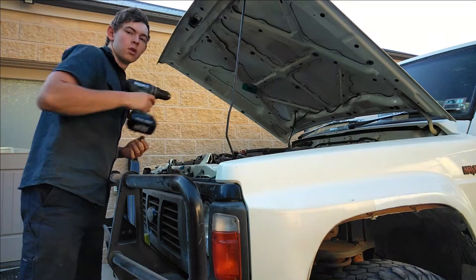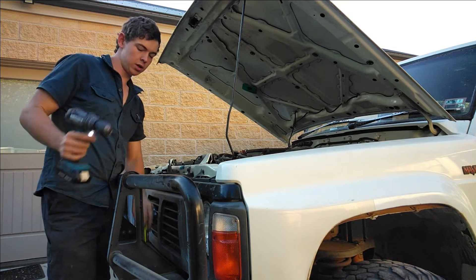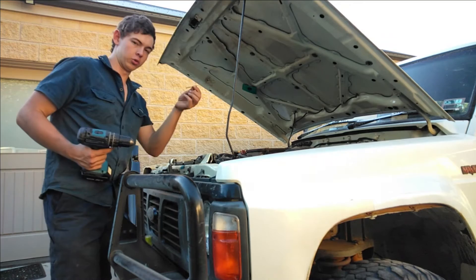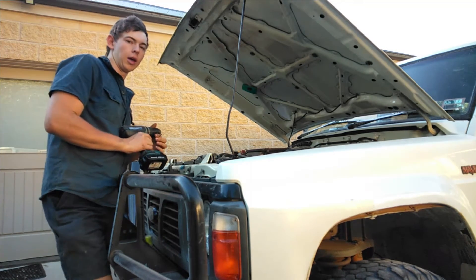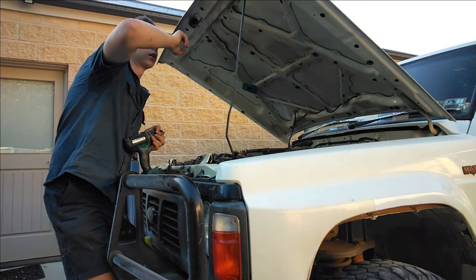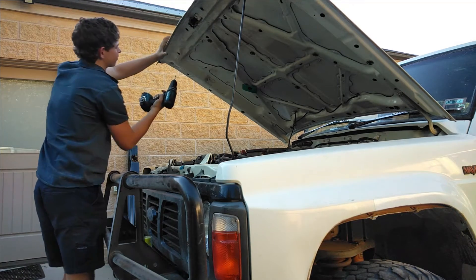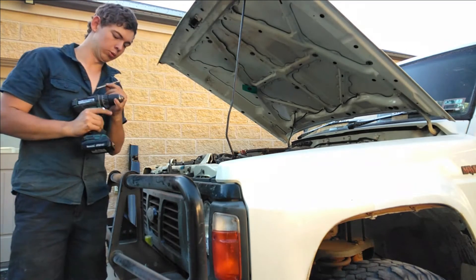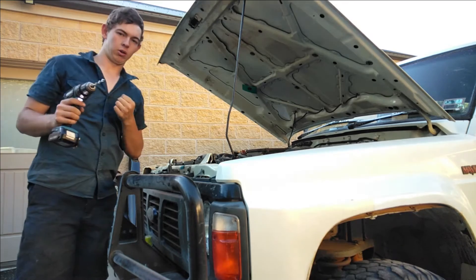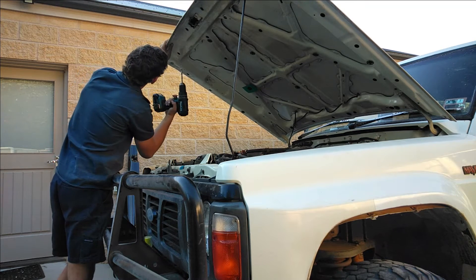For this next step of drilling the holes, you want to take the bonnet protector off and you'll need a drill with drill bits that go up to 8mm. I'm going to pre-drill mine with a 4mm drill bit just to make the drilling a little bit easier for the 8mm, and so when I am drilling it doesn't punch through the bonnet. Drill these holes in the center of that crossways slotted hole — 4mm first, then 8mm. The reason you want 8mm is because there's a little lock nut thing that goes up in there, as the instructions tell you.